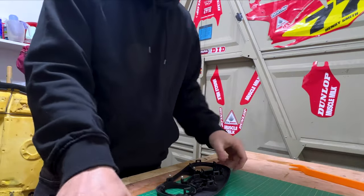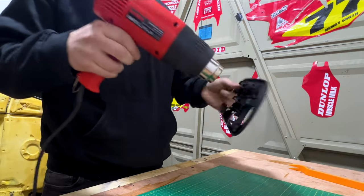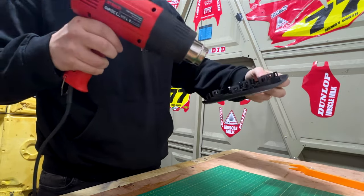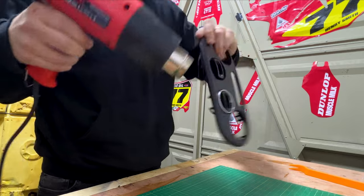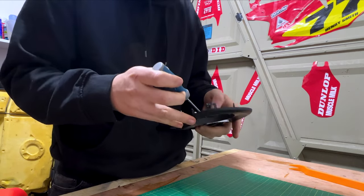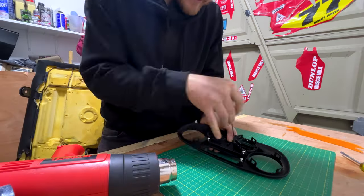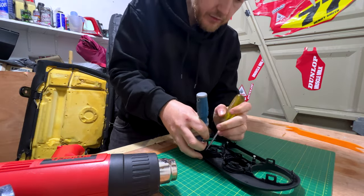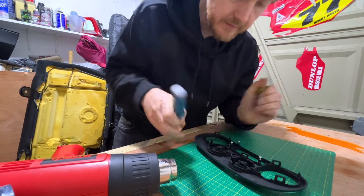It's quite cold today so I'm just applying a little bit of heat onto the plastic to hopefully make it a little bit more flexible. I think that's the secret to getting these little prongs to release from their housing. They shouldn't be too hot because it makes the plastic brittle if you do it too much. I'm going to go from the top one, and then use the other one to push down and back on the plastic just to get it to pinch off like that.